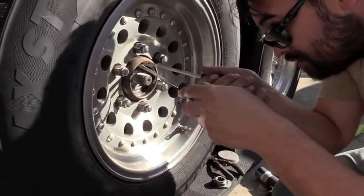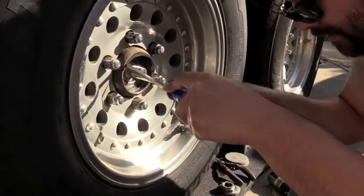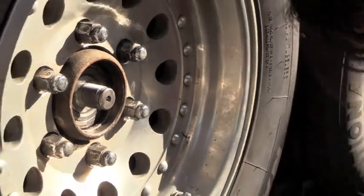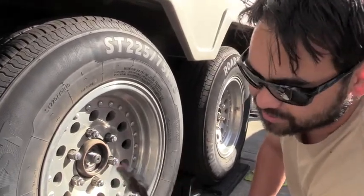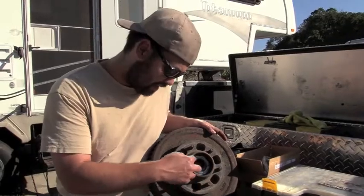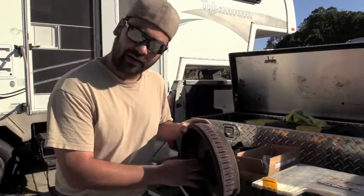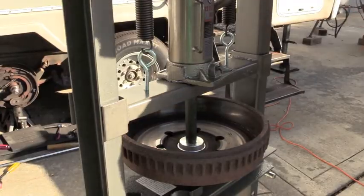I just don't want to break it. I don't know where we would find one of these snap rings right now. I'm so glad that ring came off. Now that I broke these, I think I need to go get another pair so I can put it back on. Let's try out the new press. We removed that snap ring from the outer side of the hub — it was located right here. That's because the bearing pushes out this direction. So we're going to push from the back and push this bearing out, then flip the hub over and push the new bearing in.